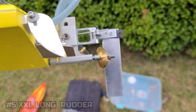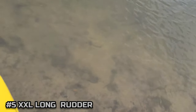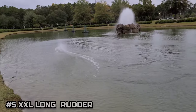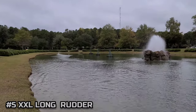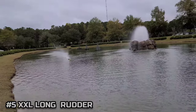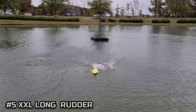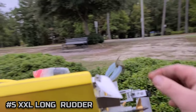Here's the long rudder and how it looks on the boat. I think this one might be the slowest because it's so long. At 75 percent — it's not helping the turn at all. A lot of times if your rudder is skipping out in a corner, your rudder is too short. The most bounce I've had so far — it doesn't even turn good. 39 miles an hour — it is the slowest. That's the worst rudder we've got.